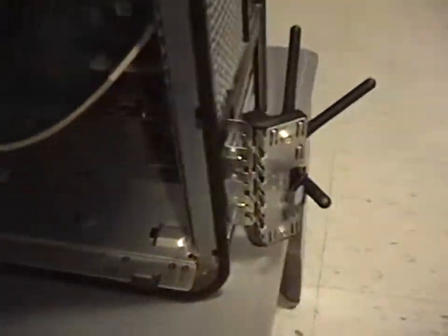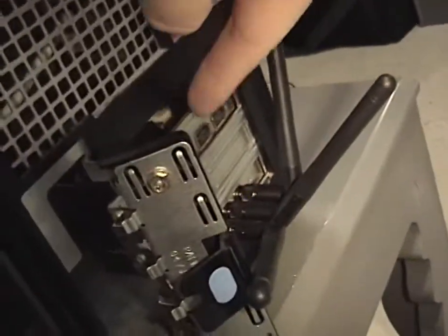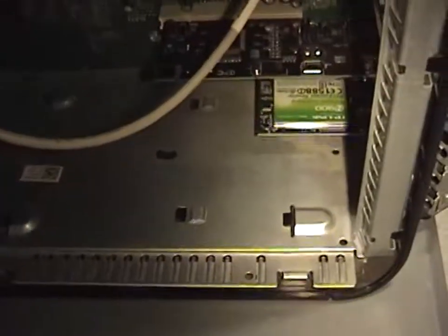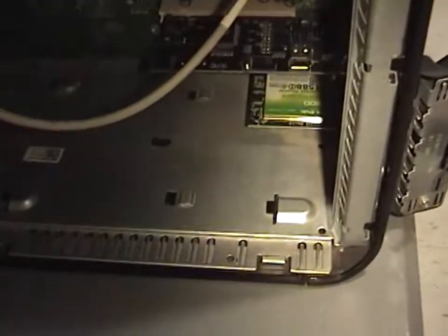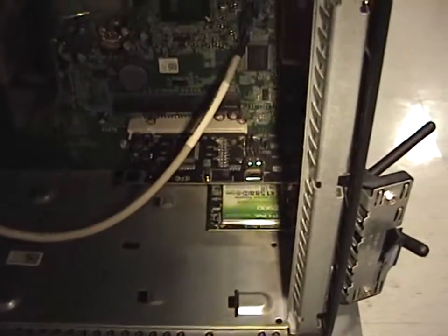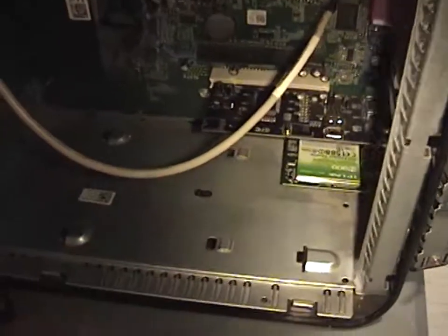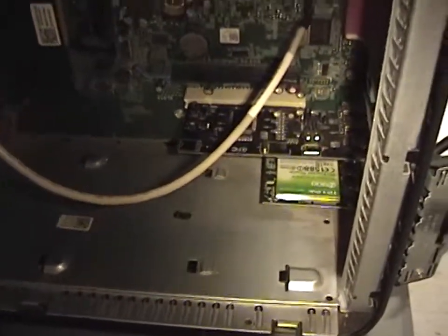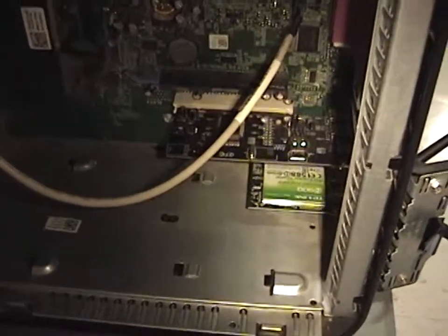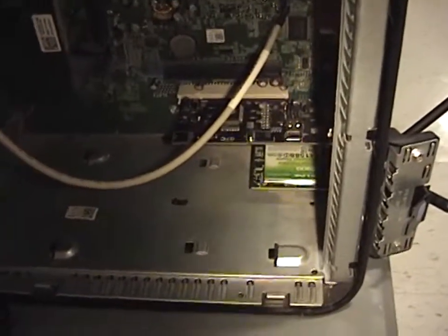So awesome. I've been still having an issue with this computer where if I have to reach around and plug a FireWire cable into the FireWire card or unplug a monitor cable or whatever, I get the blue screen of death when I start fiddling around the back of the computer. So I think one of these cards, either the video card or the FireWire card or the network adapter, is not making a good connection, and when I fiddle around there, it causes a blue screen of death. So I've reseated the cards again. I don't know why they would not have a good connection. I've very rarely seen that in computer expansion cards, but anyway, I reseated them. Hopefully there won't be any more issues.